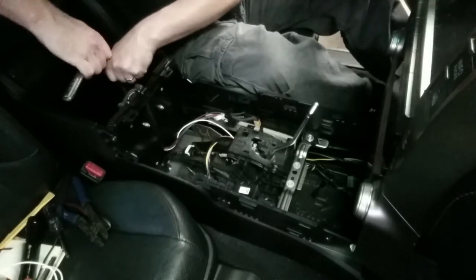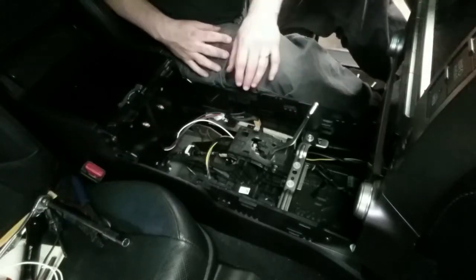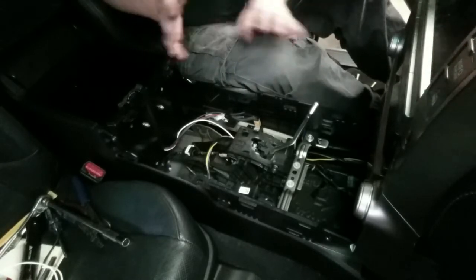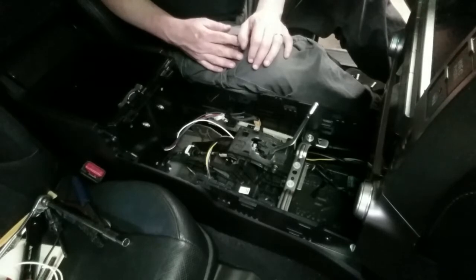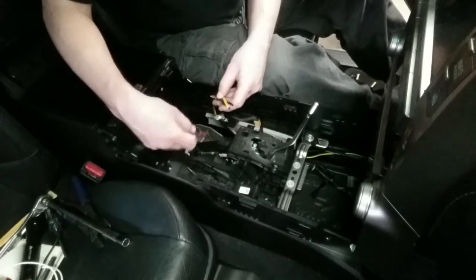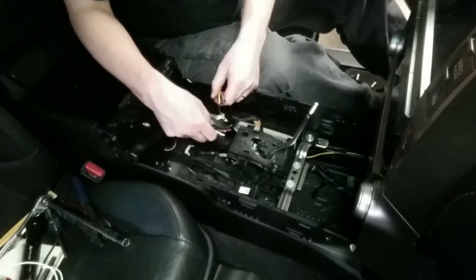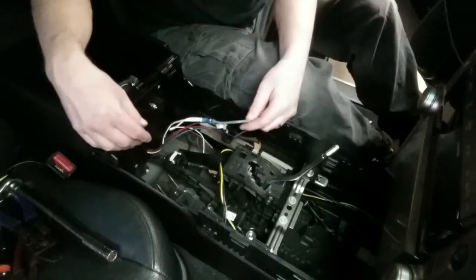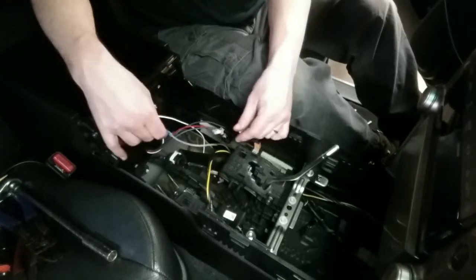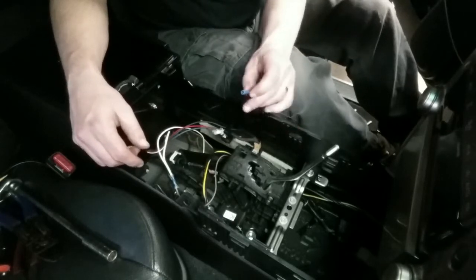I have not plugged the harness into the connector up there into the vehicle yet, because I want to get this completely hooked up first. Okay, I mentioned I was going to have to use some different color wires. I wrote down which wires were going to be what, so I knew ahead of time what I was going to need to connect to what, so that is done. I've already spliced the white wire, and this extra white wire goes down to a ring terminal that's on a ground screw. I'm using these little crimp connectors now.